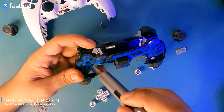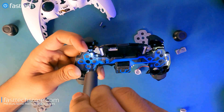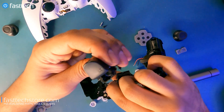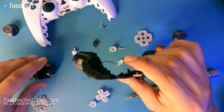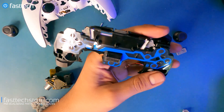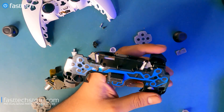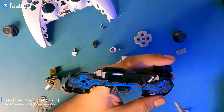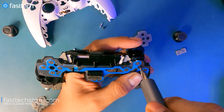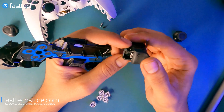There are screws at the front that we take out to remove the triggers at the back. Now that those screws are out, we've got the L2 trigger completely separated from the controller — that's how you replace the L2. I really wish Microsoft had gone with haptic triggers on at least their Elite controllers, because that's a feature I really like about the PS5. Overall I prefer the Xbox Series X over the PS5, but I really wish it had this feature. Now removing the R2 trigger — again two screws — and the R2 is also out.